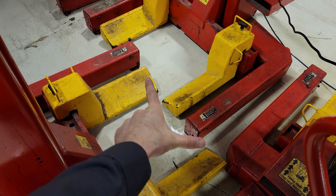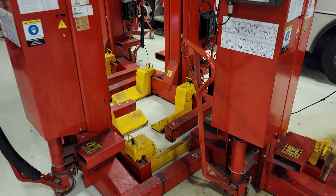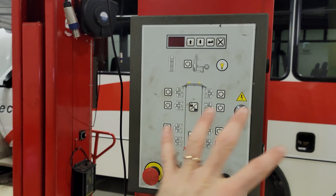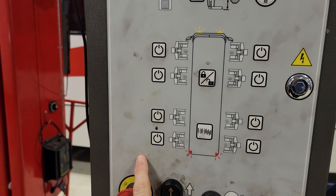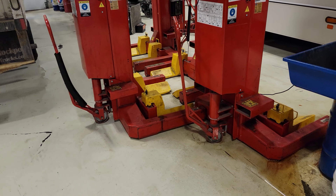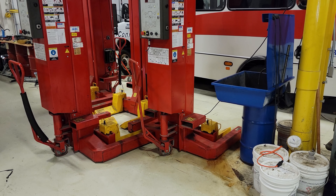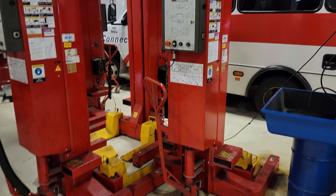You can see I picked the front tire up just with the edges of these arms. These slide back and forth depending on how wide your wheels are on the particular unit you're lifting. These are not wireless, so if we have to use all of them together we have to link them all. You go around and set each corner. I've done a little speed-up video of me hooking these up. I've even worked on a vehicle outside — I rolled these outside to take a propane fuel tank out. It was a beautiful summer morning.